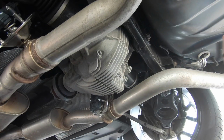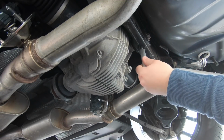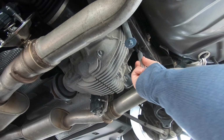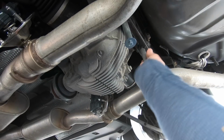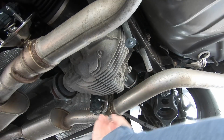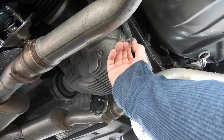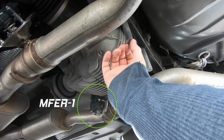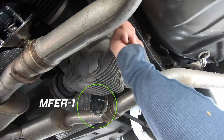All right, so this is where we are now. We're underneath the car. We've got these 2 bolt holes right here, and you need to make sure these are threaded. There we go. Just needed to get a good eye on there. If yours are not threaded, you need to put that information in when you place your order, and basically they're going to send you the proper rivnuts and a set to go with those rivnuts so you can do your install. If you have a diff brace, I don't know how this is going to work out. I'm pretty sure you're probably just going to have to do a little bit of work to get all this stuff to bolt together and come around the same height.